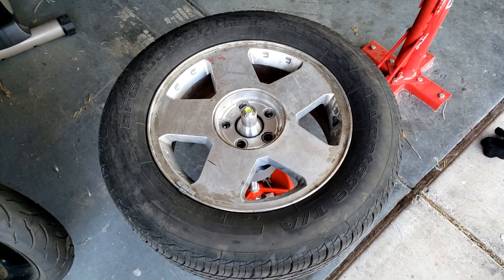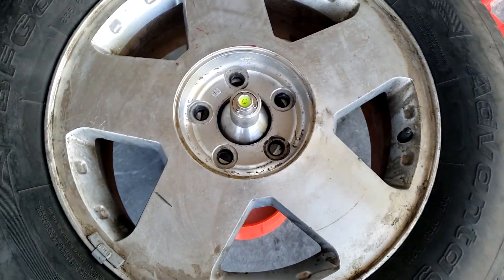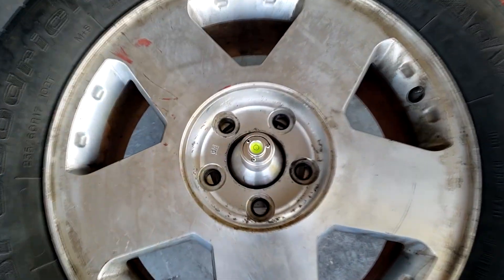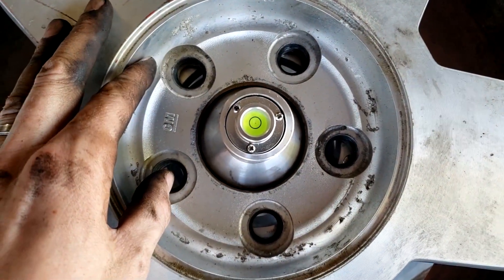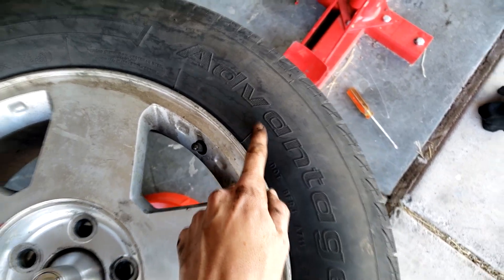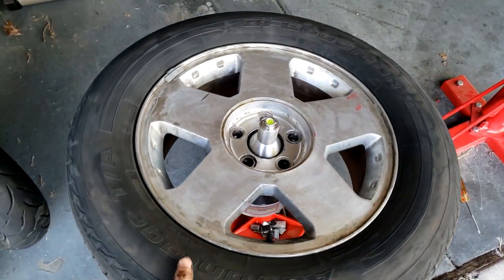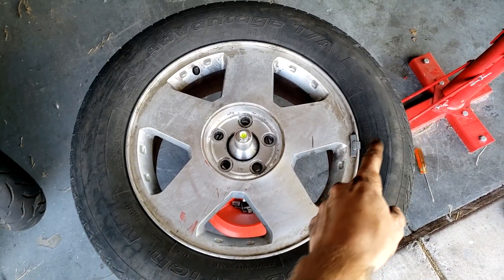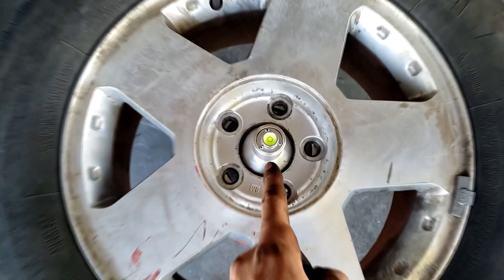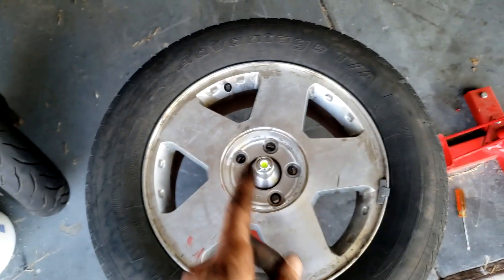When balancing a heavy wheel you don't really have this problem, but with a light wheel sometimes it doesn't push all the way down — so just push the wheel down and make sure it's fully on the balancer. Once you've done this, rotate it, bob it up and down, and wait for it to come to a complete stop. Once it's stopped naturally, we're going to find out where the bubble is on the actual wheel. You can see it's slightly off from center towards the V in 'Advantage' right here, so now we know that's where we need to apply some weight. We're going to rotate it again, bob it up and down, and see where it comes to a stop. The V for Advantage was over here before, and it's come to a stop here with the V over here again. We need to confirm the bubble is still pointing towards the V — and you can see the bubble is still pointing towards the V, which is a good indication that this is where weight needs to be applied.